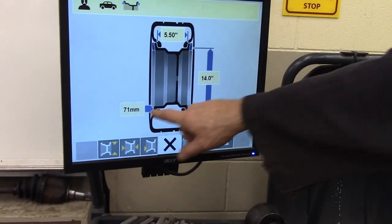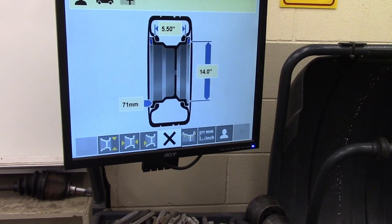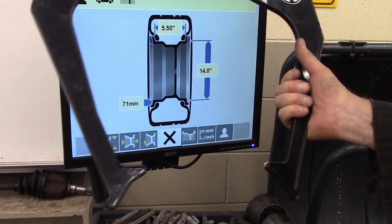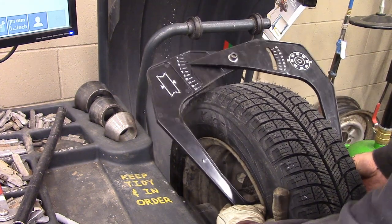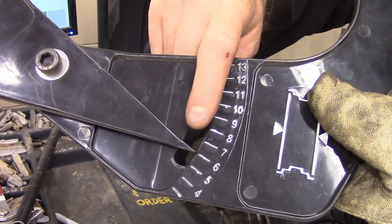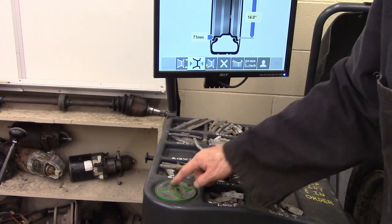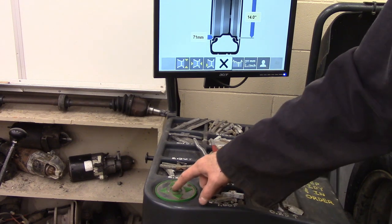You heard the beep — that tells me it's a 14-inch wheel, 71 millimeters away from the machine. I need to make sure this is correct. For that, we're going to use this device, which looks medieval. Stick it against the rim where the weights actually go, and this tells me it is a 6-inch rim because that pointer's at 6 inches. Use the navigation thing to set the width, go up to 6, and then we're good. We can exit.